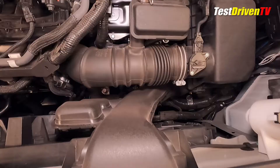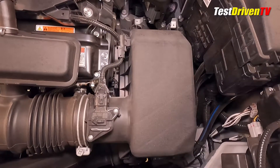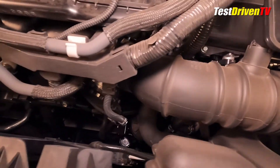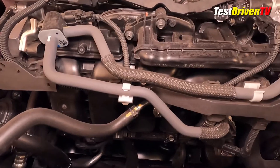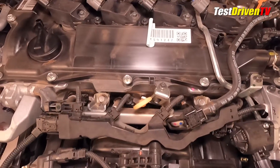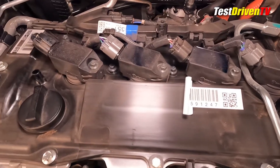Following the airflow, the air intake charge comes through a snorkel at the top of the radiator to a small air filter box mounted low on the driver's side. From there, it flows through a mass airflow sensor and into a drive-by-wire throttle body, and then into the composite plastic intake manifold at the front of the engine. At the top of the manifold, you can see its fuel injection components for port fuel injection, but the majority of its direct fuel injection components are hidden below its composite plastic valve cover.